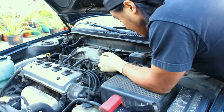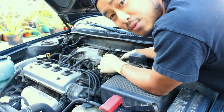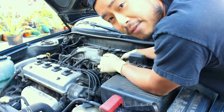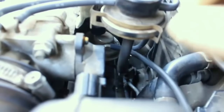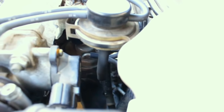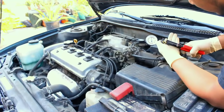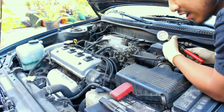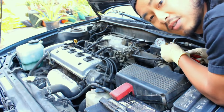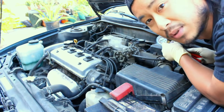I'm going to let the car warm up a bit and we'll see how bad it stumbles. On this car the EGR valve is located right here behind the intake manifold — I'll show you where I connected my vacuum line. Since the engine stalled, we know there's no carbon buildup and that the EGR valve is working properly.